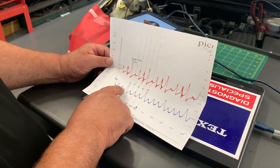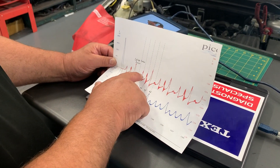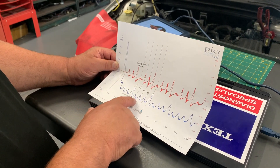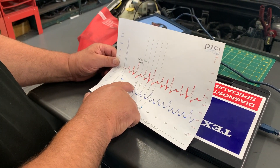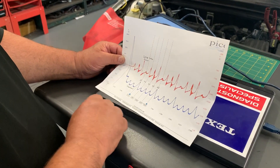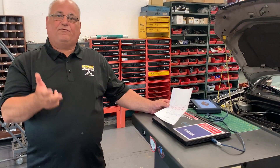Also when you see this peak up, there's no back pressure in the radiator. When you see this very low, you see pressure now in the radiator — and you should have no pressure in the radiator. Cylinder number four: real low, pressure. Cylinder two: real low, pressure. Cylinder one: we have a lot of compression here, zero radiator pressure here. So if I had to throw a compression gauge on this motor, I would find that cylinder number one has compression, but two, three, and four do not.